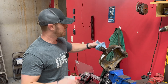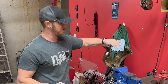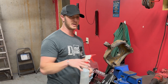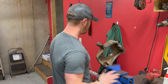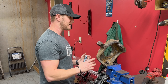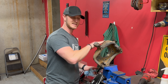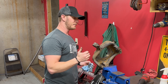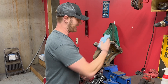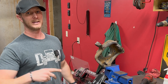Once you've got your hole cut, come back and use some acetone to clean off all of that cutting oil, because you don't want that getting into your weld and causing porosity. Before we actually start any welding, we're going to put our bolt through, follow the instructions, lay out our pieces, and then come back with a marker and mark off everywhere that we contact the cast. Then we'll take everything back off, clean it up so we have a good weldable surface, because we have a lot of old rust on the outside of this knuckle that needs to come off.